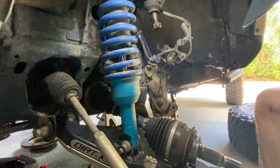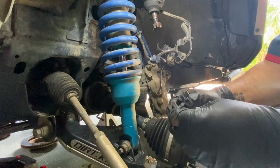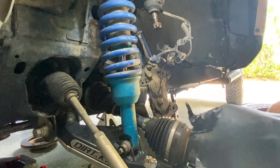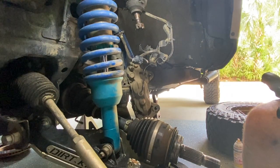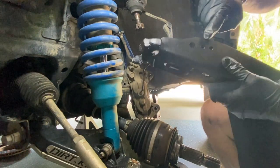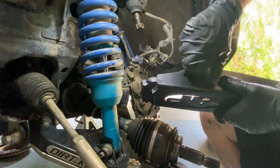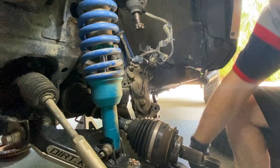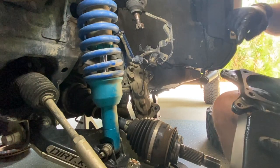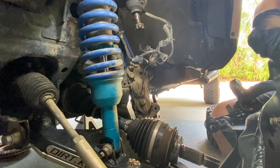What I'm going to do is pop off the housing for the ABS sensor — give it a couple taps, make sure it's nice and clean, and we're going to transfer it over to the new one. These are the bolts that hold your brake line bracket and sway bar, so we're going to put those in. Also grab these two, which are for your caliper — just throw those in so they're ready.